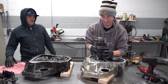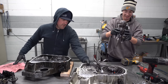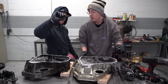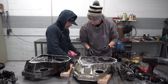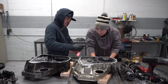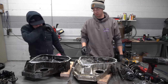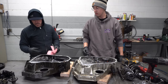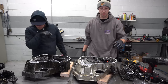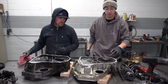Just grab it — it ain't going anywhere. The only thing that can fall apart is this one, so just focus on that. Now you've got these two on here — take these off too. See that taper? You probably know you want that off. See how this washer is tapered? The way that works is that one cones up, this is just a flat one, and that kind of helps with the deflection — when it pushes down it keeps tension. Now we need to figure out the plan. The diff is going into this trans with these gears, right? Ideally, yeah — but first we have to verify that this diff is still good.